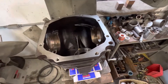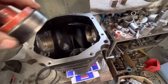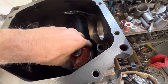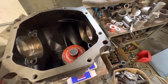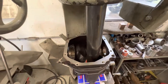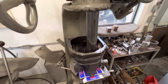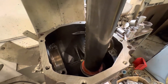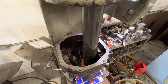Getting ready to push in the inner pinion bearing race. What we do is use the old one, which lines up perfectly, so you don't have to worry about having the wrong size pusher. On top of that is a pusher that we actually make to center it, and then we'll go ahead and send it on down. Works perfectly — awesome. When you have the right tools, it makes the job look easy.